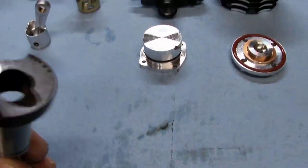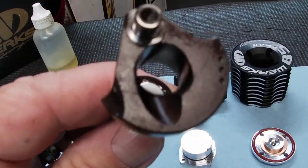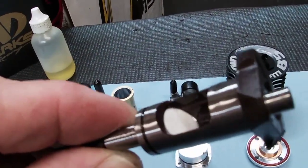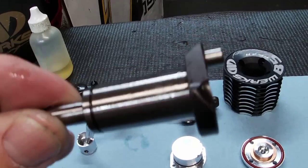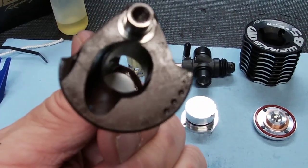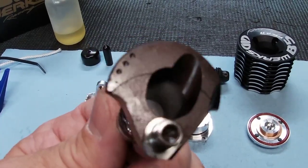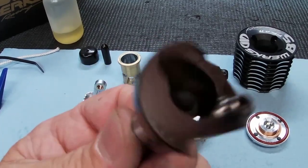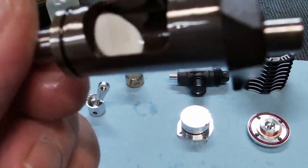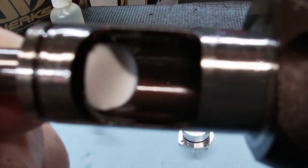Let's start with the crank. No tungsten weights or anything like that but it looks good — silicone filled 14-millimeter crank. The back of it is coated, the barrel area is coated. Still very easy to turn. This will be a good candidate to get the timing modified.